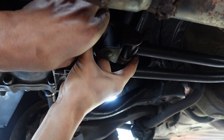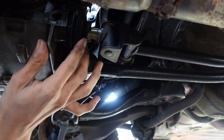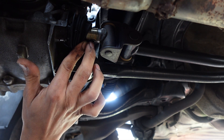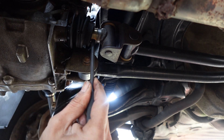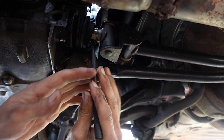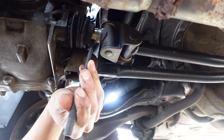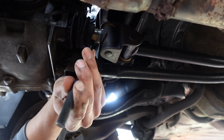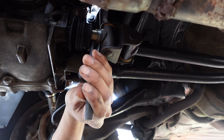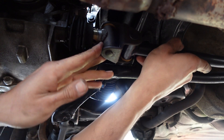There is going to be a pin. You take off this cover — just take off this little cover ring type thing — and then it's going to expose the pin. You're going to get a punch that will be able to fit and hit this on out. Just find the right size punch; this one looks like it'll work. Get a hammer and hit this on out till it's fully out. For the most part, people hate taking these out just because they don't have punches, so make sure you have a nice punch.